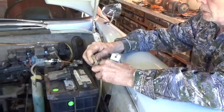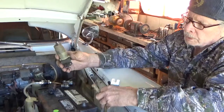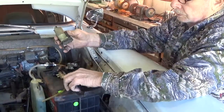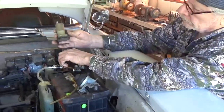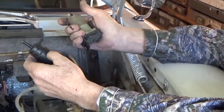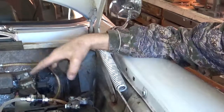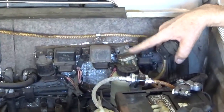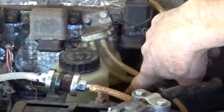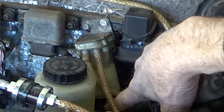What I do to save customers money is to install a later 70s electric pump, which can be this style or also this style — either one will work on this particular car. I've installed this style right here at a slight angle in order to get the electric coupling onto the prongs and avoid rubbing against the wiring harness.